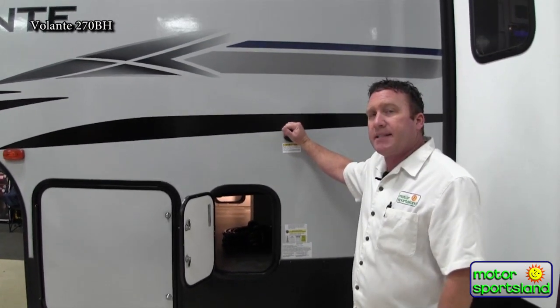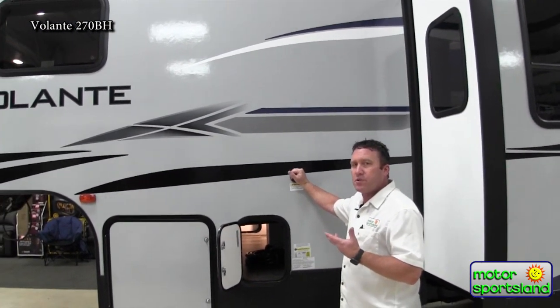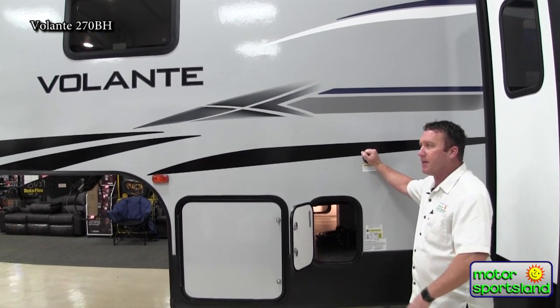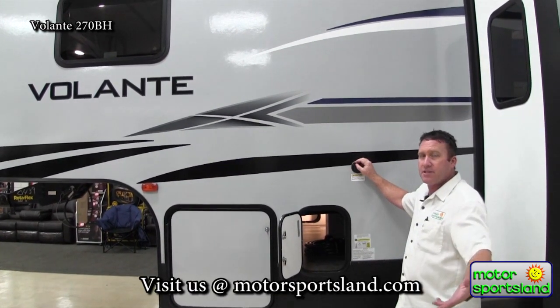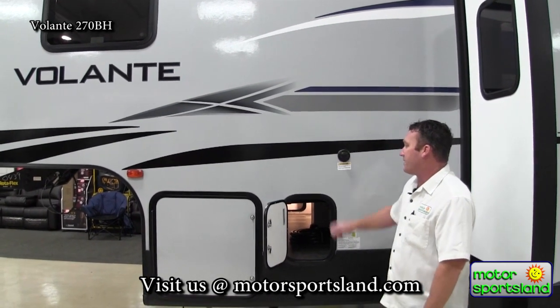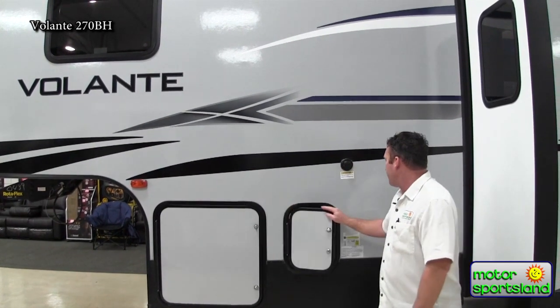Here's additional access to your storage. This is one of your black tank flushes. The best thing about black tank flushes is — if you don't have one of these, you have to take a hose, run it all the way through your trailer, stick a wand on it or something, put it into the actual toilet, and swish it around. Instead, just hook it onto here and it flushes everything out so it's nice and clean. It also makes it so that your monitors read properly because they're not having debris on them. Having a black tank flush on both bathrooms in here is phenomenal.